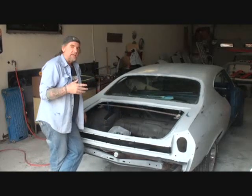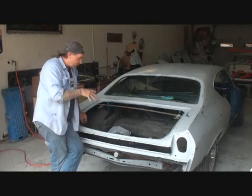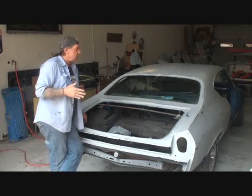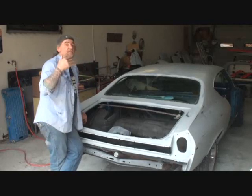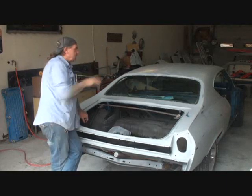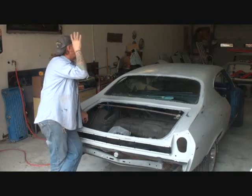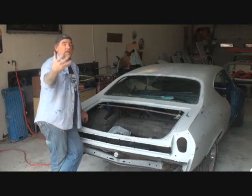Now that our car's cleaned out, I'm going to go ahead and blow the interior out as well and repeat my process. Once that's done, we're going to pull the car over to the paint booth, start taping it off, and getting it ready to spot prime so we can go ahead and do our final wet sand job on it. And when I say final sand, we're only going to spot sand it. This has already been sanded down to 400. Wherever I spot prime it, I'll blend that primer in using minimal water. Then once that's done, we'll clean the car off, and we will start painting this thing. And hopefully, it's going to look like a brand new car, doing it my friend Pete way.